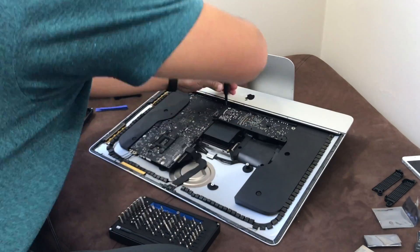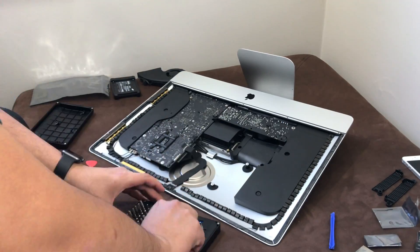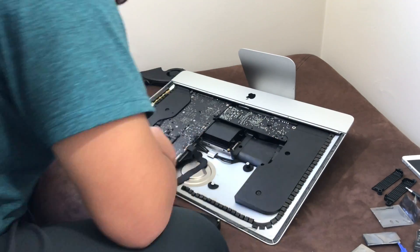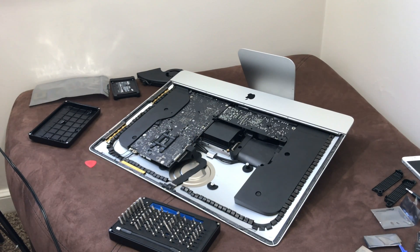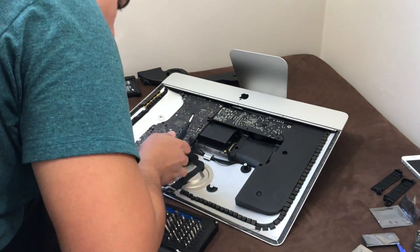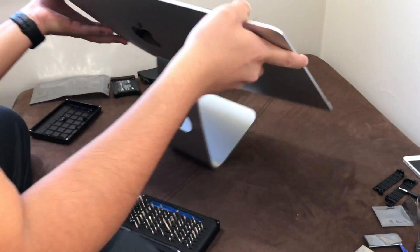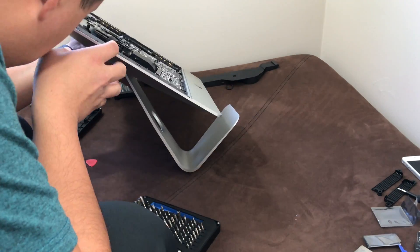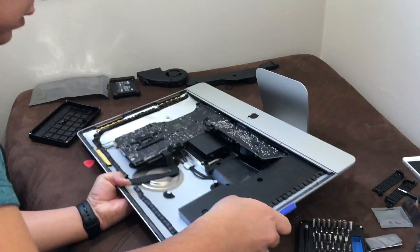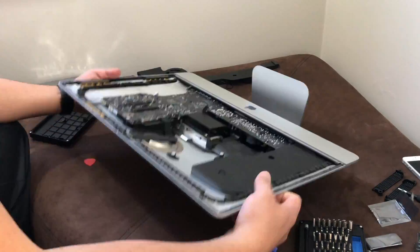I also upgraded the WiFi card, which was only able to take N-band. I have 330 megabit download and 24 upload here at home, and the N-band was only able to give about 250, which is great, but I wanted fantastic. Luckily the 2013 model had the AC-band card, so I went ahead and purchased one. It came from overseas and took a little bit to get here. It came with an adapter to upgrade older models, but I just needed the WiFi card since it was able to fit directly.